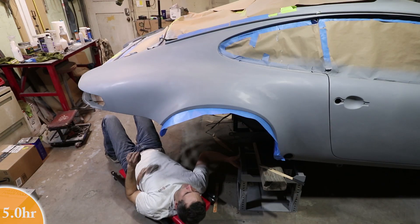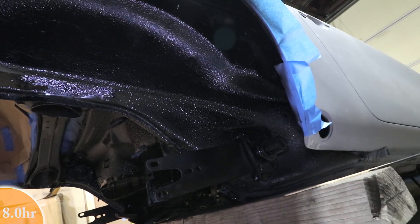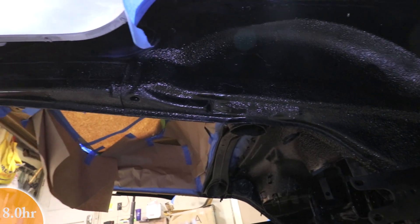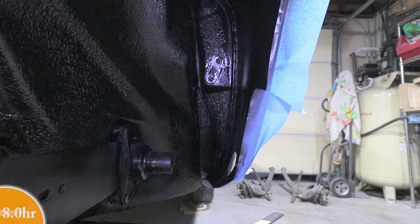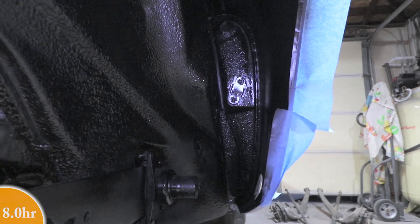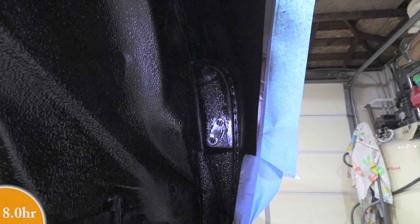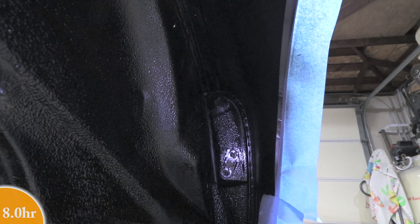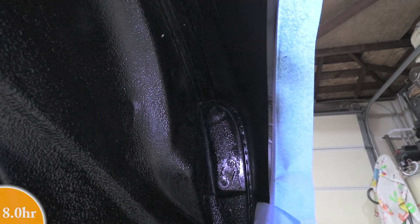Time for the creep review. This is going to be hard to see because everything's black, but this is two coats of the epoxy primer. This area here is the kidney bowl area and the latch panel — this is a highly rust-prone area, so I've done my absolute best, aside from sandblasting the whole car, to clean everything out, treat the metal, and get the epoxy primer in there really well. I think I did a pretty good job, although it is going to require some frequent inspection just to make sure everything's holding up.